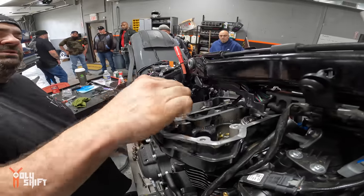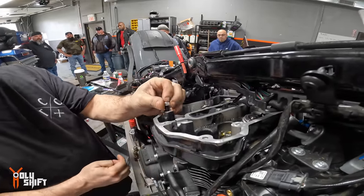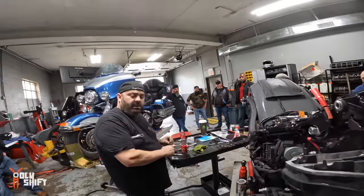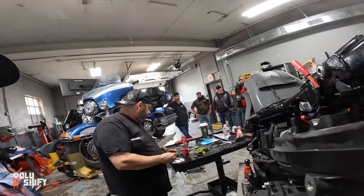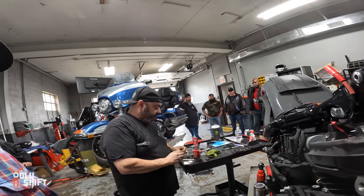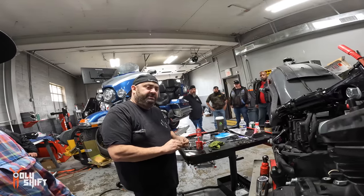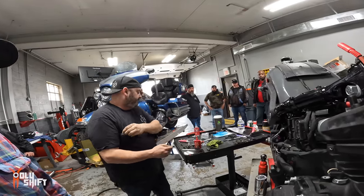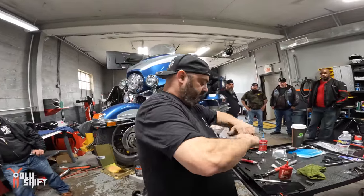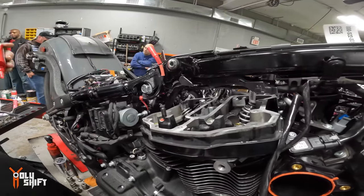We do this as common practice. There are customers that come in and are adamant about not wanting to strengthen their top end or be safe about it, and they just want to put the cam in. It's not recommended by us, but if I can't get them to do it, they don't. Nothing I can do. This would be an additional $200, $300? Well, the studs are about $150, and then we're talking another 3 hours labor. Because if not, I would just be in there cutting the pushrods and putting adjustables in, which I don't like doing. This pretty much bulletproofs everything.